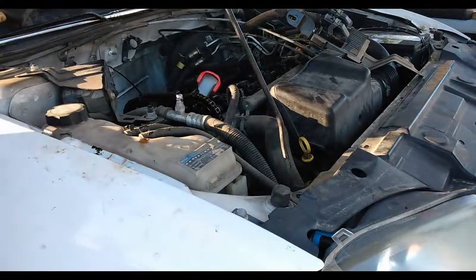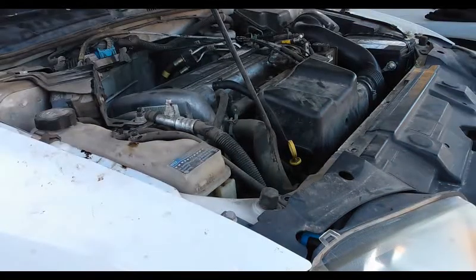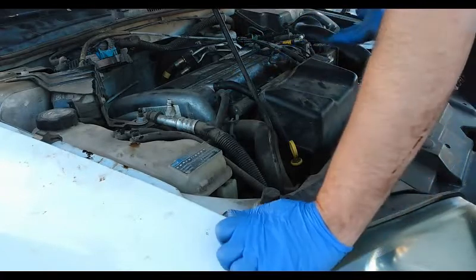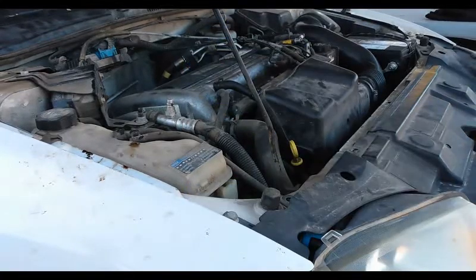Now we do the reverse for reassembly: carefully cut off the zip ties without dropping anything in the engine, put the valve cover back on, reinstall the computer, and start it up. She sounds good — nice and quiet, no timing tick like a lot of these cars have. I don't see any visible leaks around the valve cover. This is a cold start so the engine is a little loud, but no leaks, everything looks good. Take it for a test drive and you're good to go. You've now done your timing tensioner. This is STC Donnie — see you guys in the next one, stay tuned and subscribe for more Cavalier and Ecotec videos!